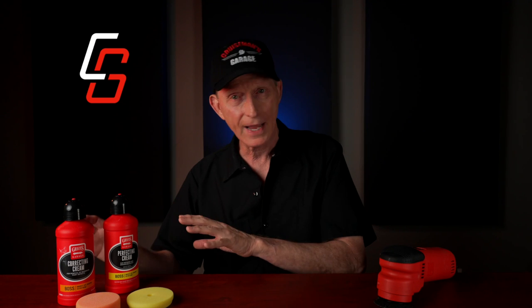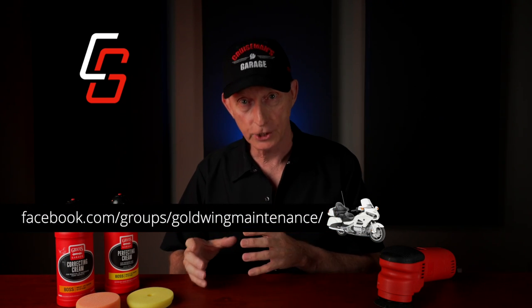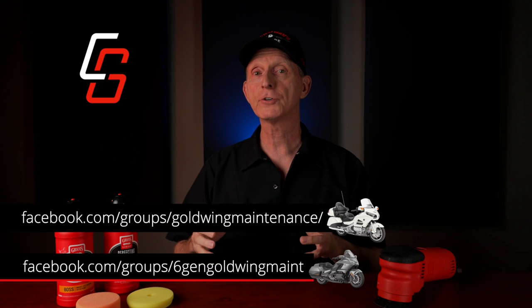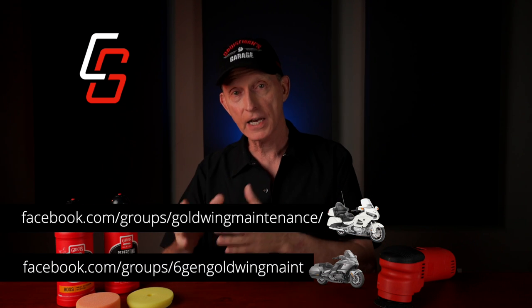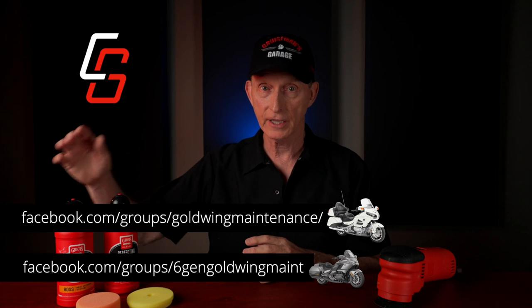you ever need. Right now, it's not so much important to focus on the brands. There's many good brands out there on the market. Just want you to focus on the overall concept of paint correction. These compounds make up the first stage of paint correction, after which we'll move on to a refining step to remove any light marring or scratches left behind by the correcting compound.